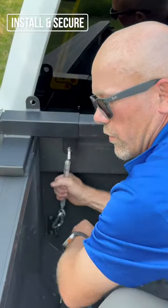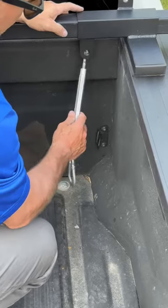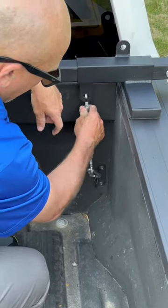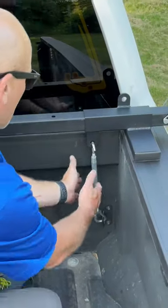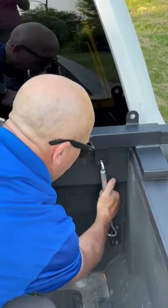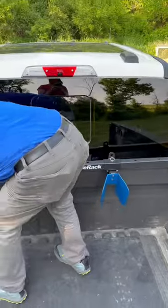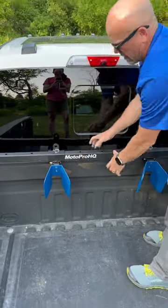All you need to do is tighten the turnbuckles relatively hand-tight on each side. Remove the turnbuckle, clip it into the factory-mounted support tie-down, then come from behind and slip the hook portion of the turnbuckle into the rack mount tab. Tighten the turnbuckle — again, only hand tight. I tighten both sides by hand, check that both are snug, and the rack is installed and goes nowhere.